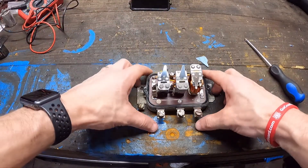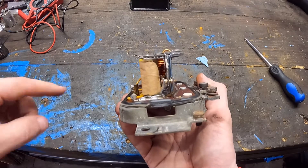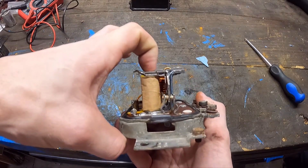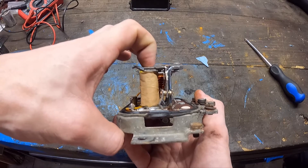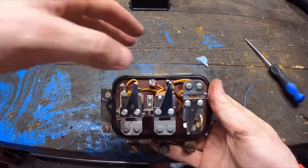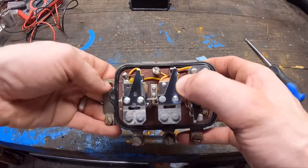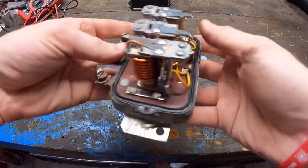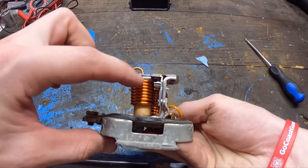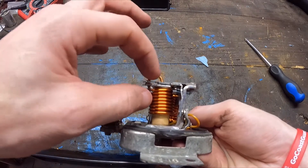There we go. Now don't let this intimidate you — there are a bunch of points in here. If you know what ignition points look like, that's exactly what these look like. As the electricity flows, it makes connections — this is going to be kind of hard to show on camera, but it makes a connection there and you can see the points on the bottom move, bouncing back and forth. In the middle there's also one here, and when you push the points it opens and closes those connections. On the end we've got one more set of points. The field relay in here is what creates a magnetic field as electricity travels through, which pulls this down and closes the connection.